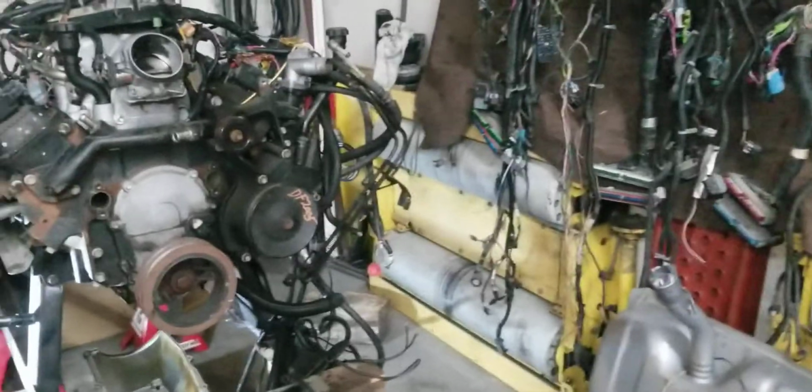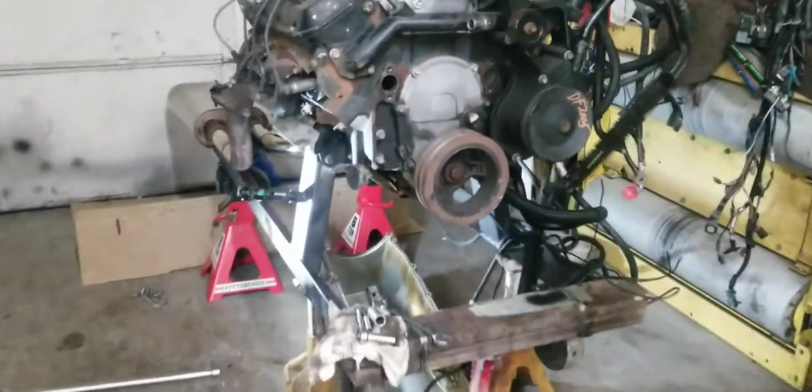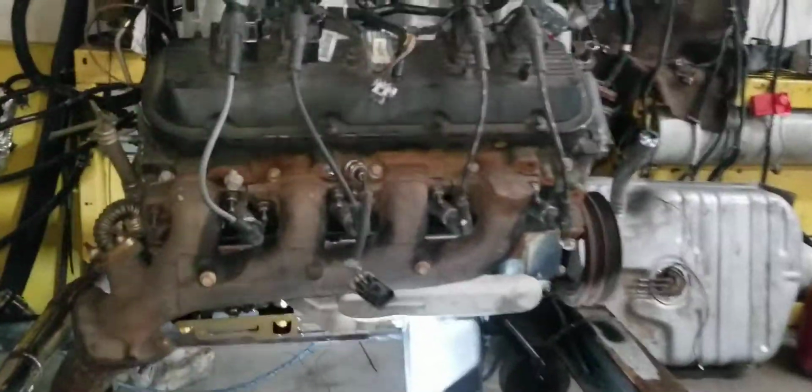Parts are supposed to be in Saturday, all of them. And that is when I'm going to do it. But like I said, didn't find anything wrong with the pump. Just the moisture on the crank. So scoping the pistons wouldn't be a bad idea, because there shouldn't have been any rust in the bottom of it. You can see the pitting even on here